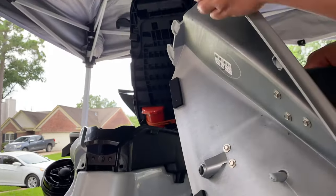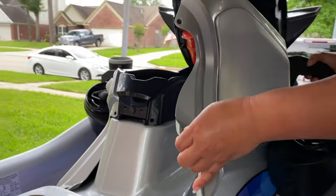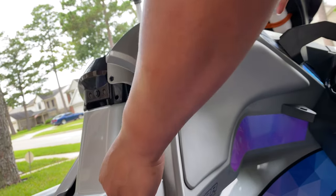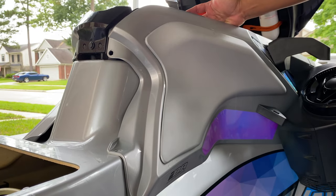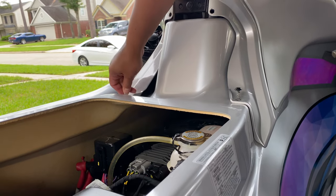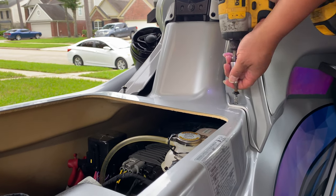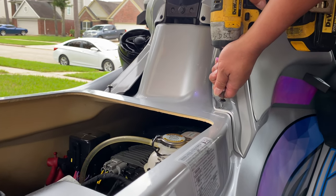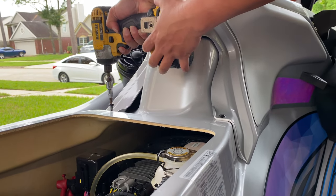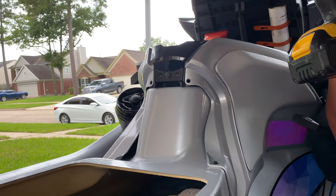See how this right here at the top has like a little J-shape — you have to slide it down inward and then go like that to reinstall the panel. There it is; it's right on top. Now all we need to do is put our screws back in and our rivets. Put them in by hand, make sure they line up, use your T30 bit. You can do it with a ratchet, or just lightly tap on it. Then put your rivets in — it's back to being assembled.